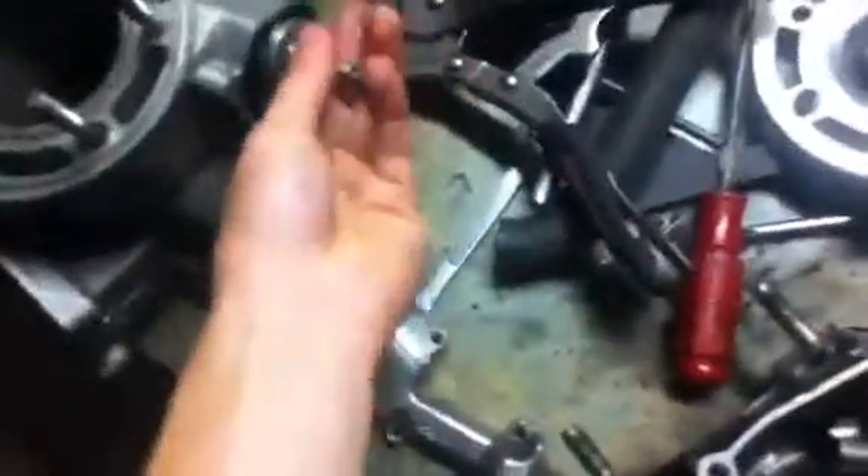So that way when I stick this power valve in here — just be careful when you do this, these power valves are strangely expensive. The power valve, now that I put it right up alongside there, the power valve does not extend into the cylinder. You do that until you can't see it, and there's plenty enough clearance — just enough that you're confident it won't hit the piston.